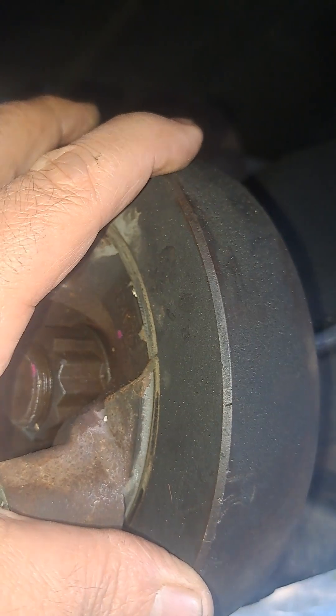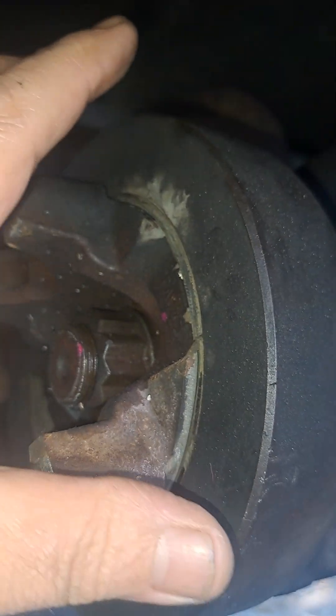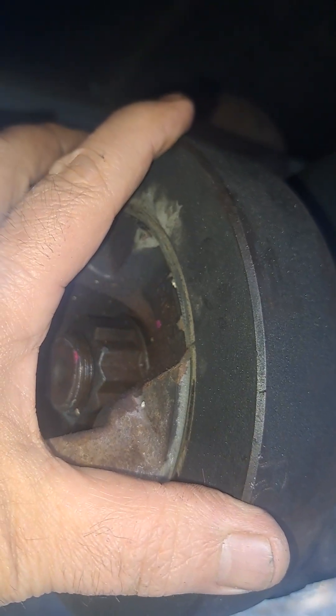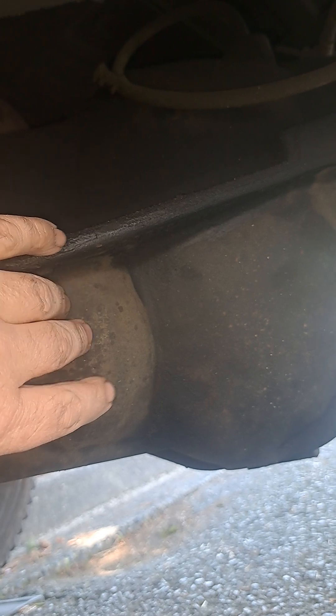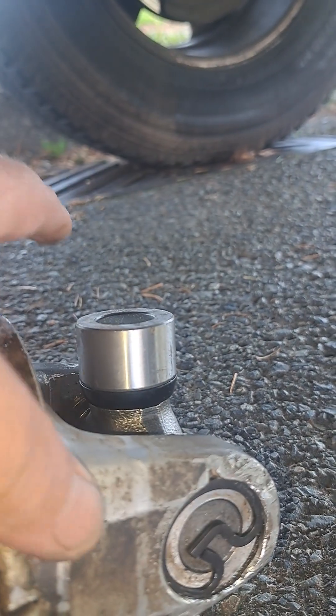Why it was swapped — I don't have that information because whoever changed it did it. Now if they swapped it and this is not factory, does that mean they swapped the rear end too? I don't know that. I'm going to have to find part numbers or dimensions, and the same thing with this driveline — I have to measure the overall length, the distance between the two spacings, the diameter of this hole. There's a lot of stuff that has to be gone through to figure out what they changed and what they didn't.